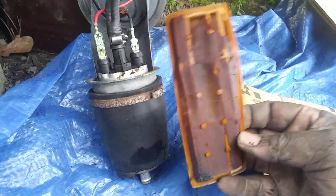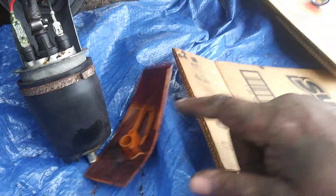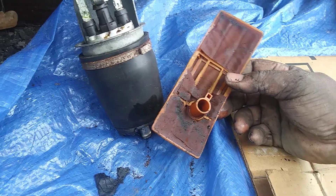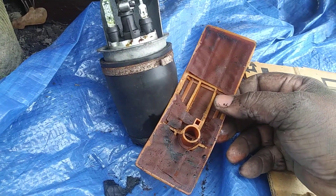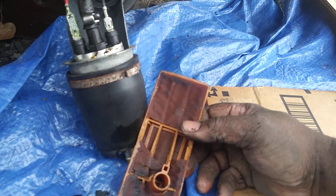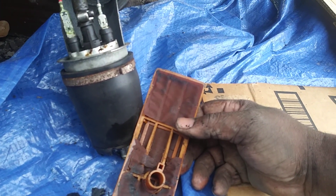See right here — just broke away, that's the fuel pump, the seal is gone. What actually ate this fuel pump up is the strainer. The strainer wasn't catching the trash out of the gas, so it got right in there and burned it up. Couldn't do nothing but burn the fuel pump up — wasn't gonna keep running that way.